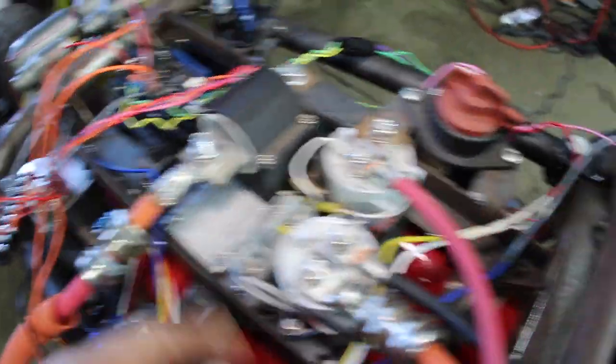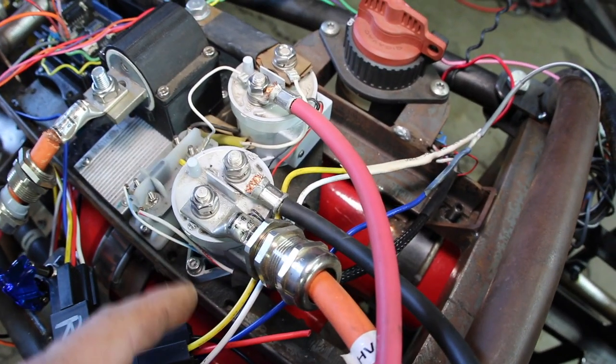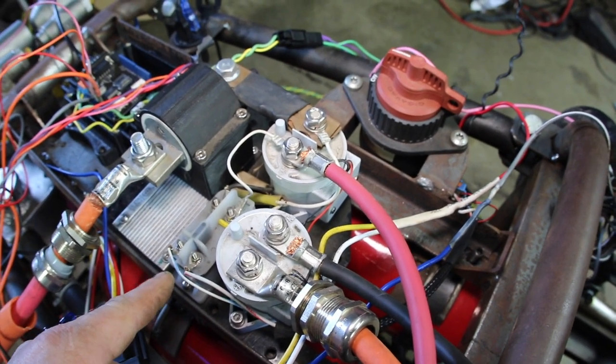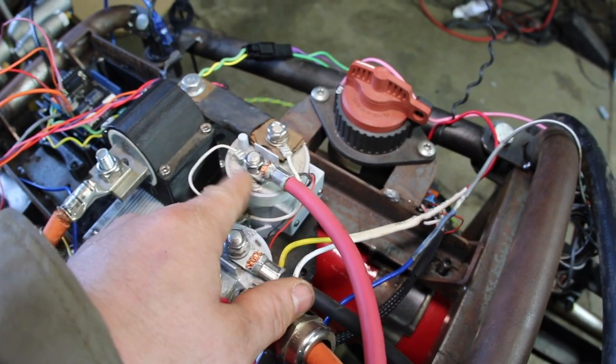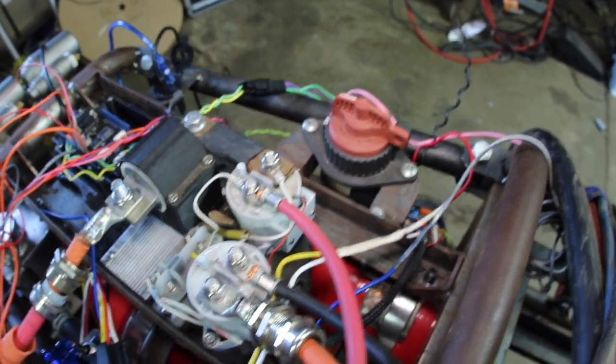See positive — and this just goes right back to the negative. Upon startup this one is going to click on immediately, and then I have to hit the pre-charge to leak the energy into the capacitors. And then we can pop the full contactor so we can avoid spark. So that's how I get the high voltage to the motor.